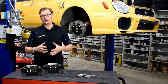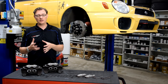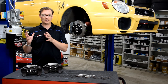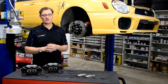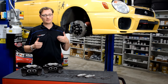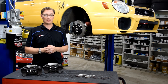There's the obvious reason that if you're going to put on a larger brake caliper or rotor, wheel clearance can become an issue. But beyond that, something definitely worth keeping in mind is that if you're going to put on a big brake kit, how effective it can be is limited by the traction your tires have. If you put on the biggest, baddest brake kit but you're running skinny all-season tires with 600 tread wear, that big brake kit is basically just going to get you into ABS very quickly and won't stop the car much more effectively.